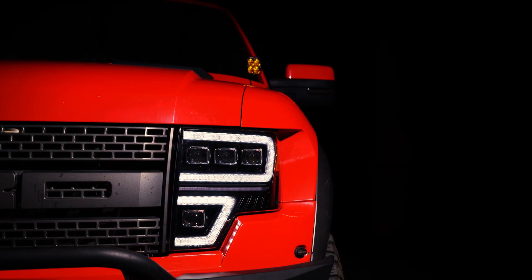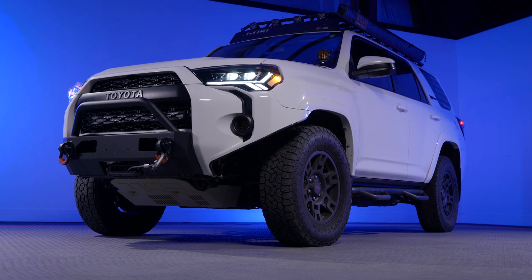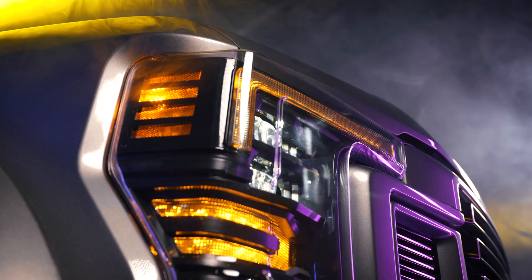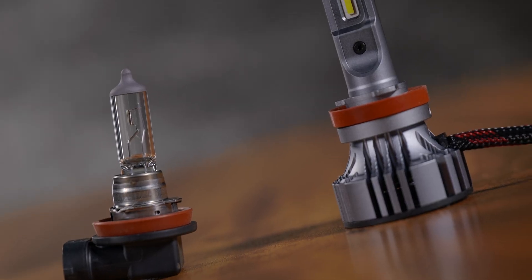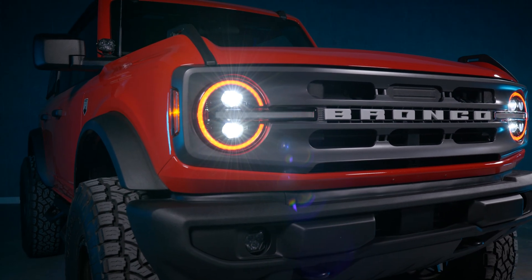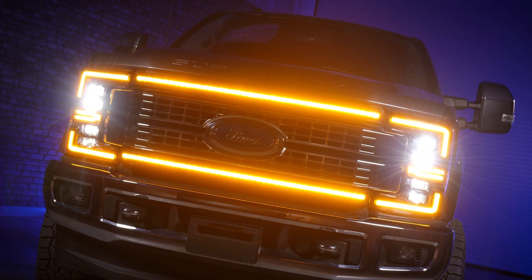Now, if you don't want to just change the bulb, you can replace the entire headlight housing assembly. I've seen tons of really good headlight assemblies from Alpharex, GTR Lighting, and Morimoto Lighting. The big kicker is — is upgrading these lights even legal? To be honest, if you're going to replace your halogen bulb with a different halogen bulb, that's fine. If you're replacing your halogen bulb with an LED bulb, that's not technically DOT compliant. For street-legal DOT-compliant upgrades, stick to the original bulb type, or upgrade the entire assembly to something like the Morimoto XB headlights, Carbide headlights, or Alpharex headlights. These aftermarket LED headlights are street legal, look better than stock, and perform better than your original lights.